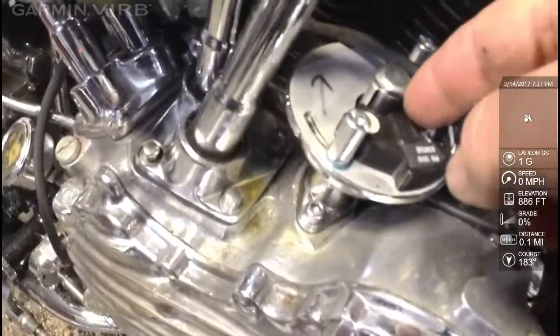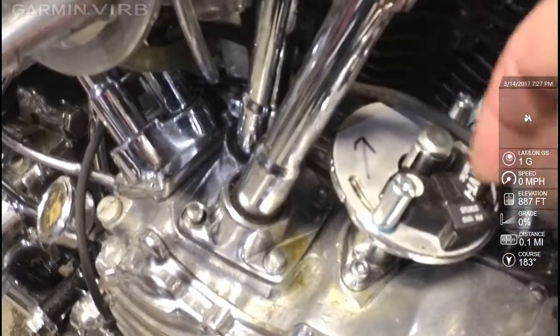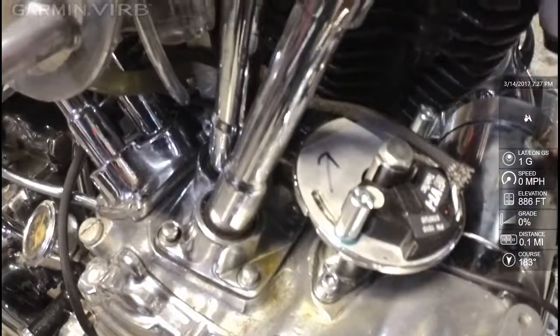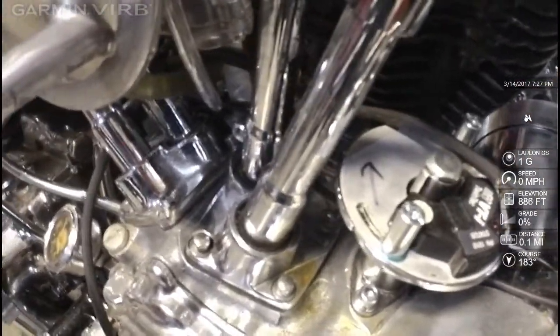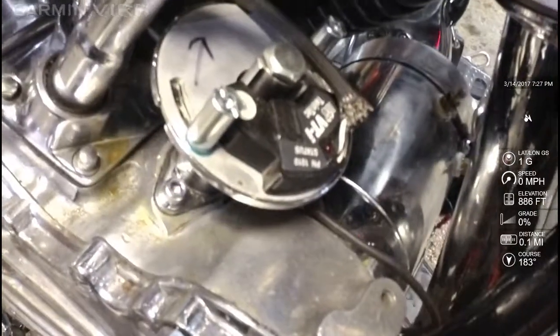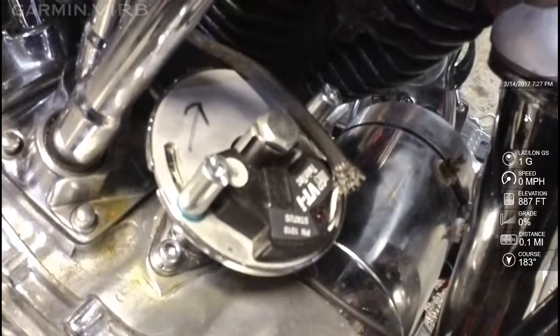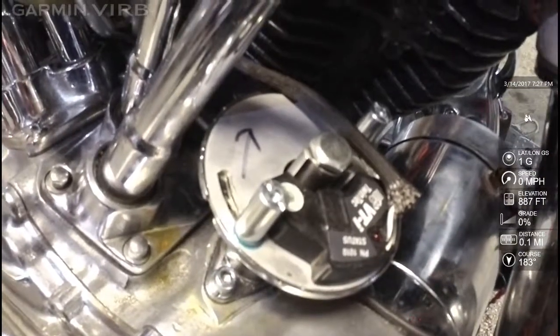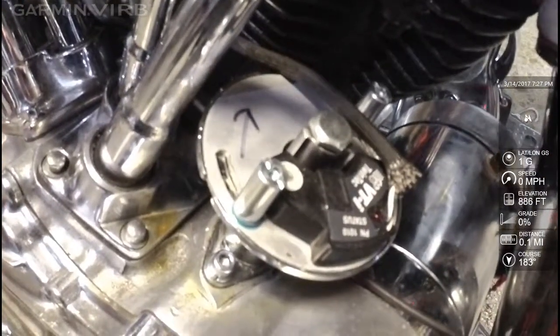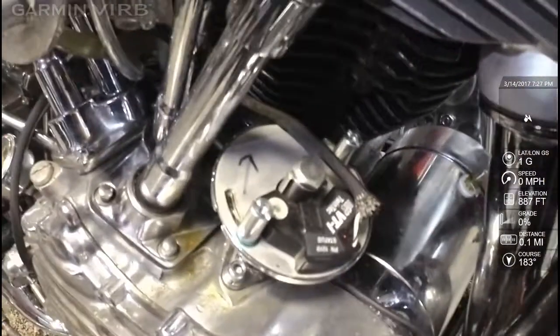And that allowed me to line up my new cam and the pickup here on the VTI. I think — though I'm not sure — that means the last guy that worked on this bike installed the distributor wrong. And they were fighting with that. That's one reason why this bike never really ran.